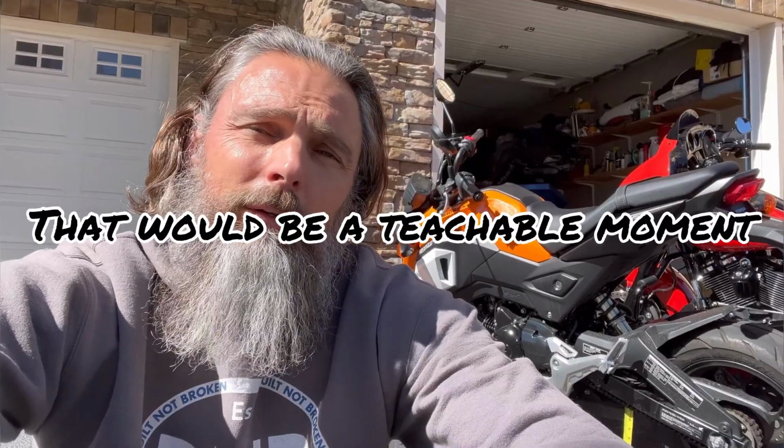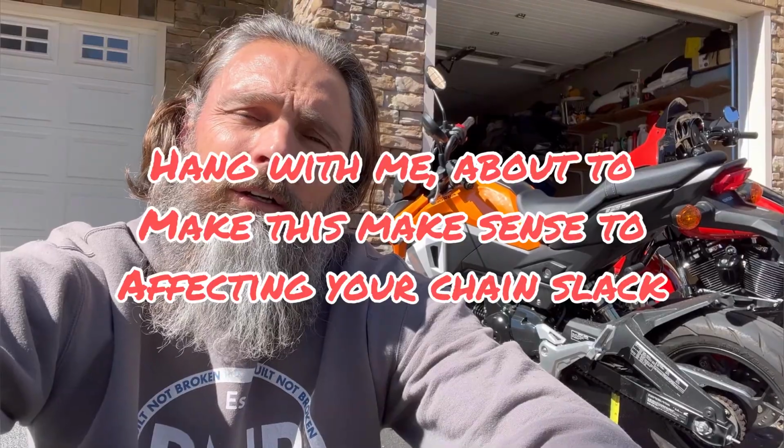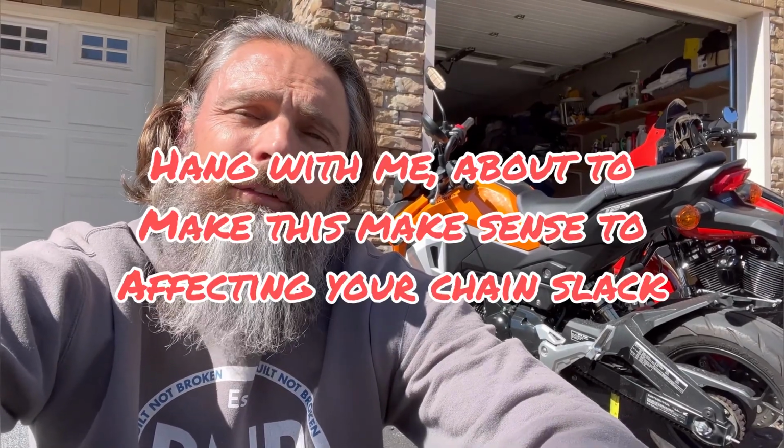So out of habit, I got off the motorcycle right here. I had tension on the gear. I turned the bike off. I let the clutch out. I let the bike roll backwards a little bit. I put it on the kickstand. That way it can't roll backwards anymore. But let me show you what happens when you do that when you're trying to adjust your chain.